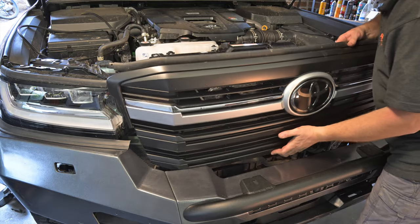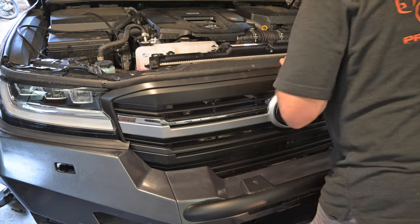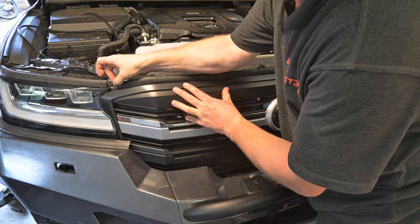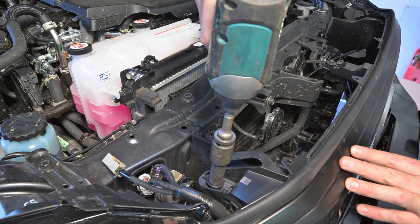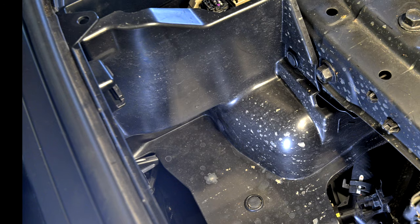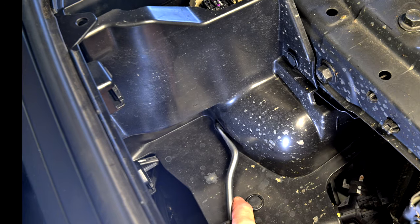You can now refit the grille. Let all of the wiring looms and the headlight washer hoses fall down into the gap between the radiator and the bar. Then lower the grille into place and slot it into position between the headlights. Re-engage the seal on the top of the grille with the seals above the headlights. Then refit the three bolts securing the top of the grille to the radiator support panel. Then using a trim tool, remove and discard the lower forward-facing plastic clip on the plastic ducts behind the grille — there's one clip located on either side of the car.